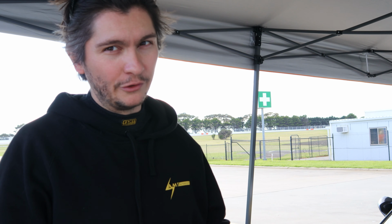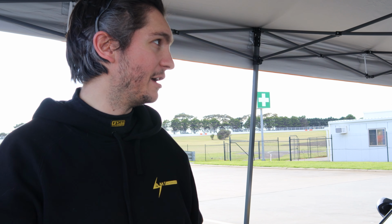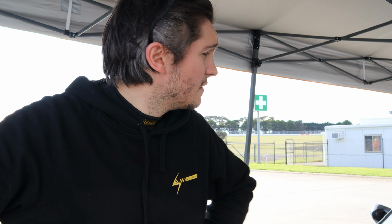Just went out for first practice session. It works, which is cool. First time we've had all the gears, which is nice. Getting into fifth was really, really bad. That spring mod I did for the reverse lockout shifter, it's better than nothing, but it's not great either. Clutch release point is also really, really low, so sometimes going from like third to fourth into Siberia, Phillip Island here, jerks really quickly. The Michelin slicks are so much better than the Pirellis, oh my god.